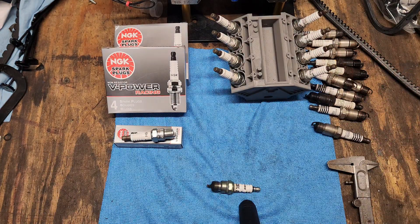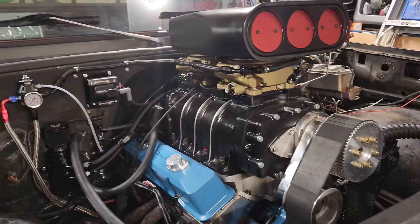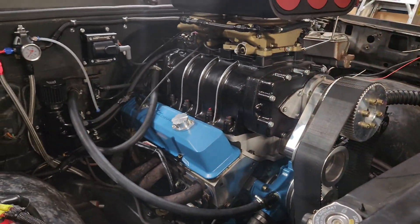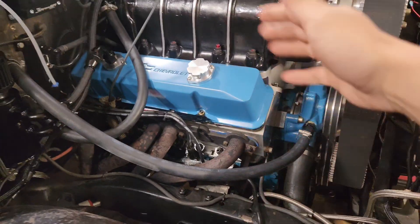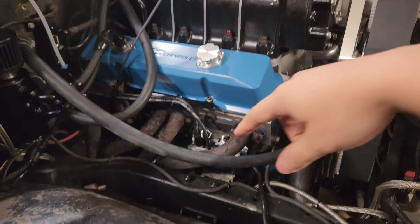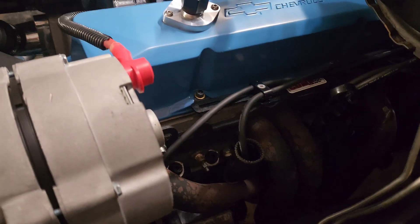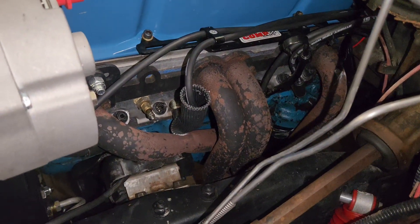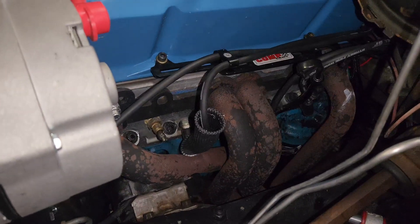If you haven't subscribed already, subscribe down below. Let's go check out the engine these are going in. This is Hank's supercharged 350 small block Chevy — the budget blower on the budget build. I have a set of Excels in there and I want to get the NGK plug in. On the passenger side you normally don't have a clearance issue. The issue is over here on the driver's side. You can see that spark plug wire with the heat shield on it — that's because it's really close to the number one primary tube. These are not angle plug headers, these are just straight plug headers, and that's the issue I'm having on this build.